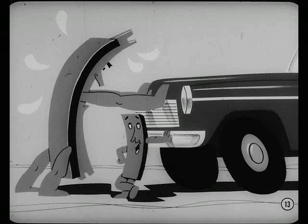Actually, the primary shoe does only a fraction of the braking. The secondary shoe does most of the job. The primary shoe's main function in forward braking is to energize the secondary shoe.